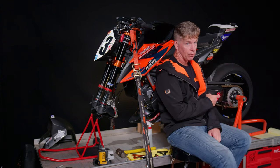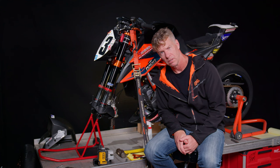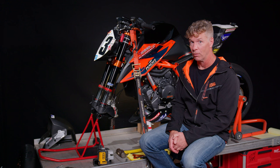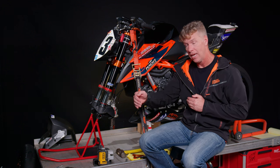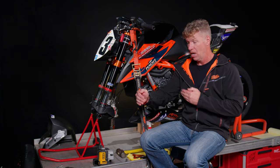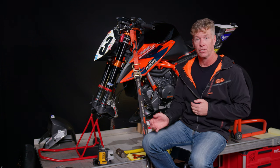It's easy to assume instability comes from the front, but I believe it comes from the rear. We already established that this bike comes with enormous trail — so much trail. If trail equals stability, why are we having instability problems? Doesn't make sense. That's because it's not coming from the front. Remember the leading edge and the tire — when that tire is out of whack and touches the ground, whack, it goes back. When it's over here, whack, it goes back. That's just the nature of having a lot of trail.